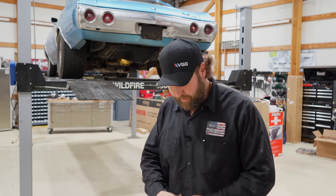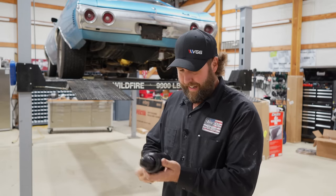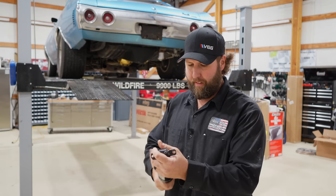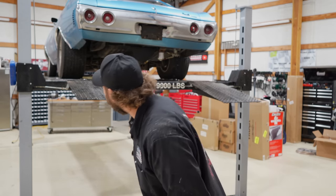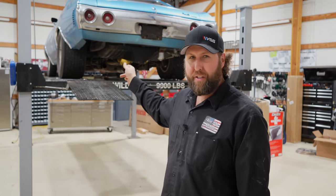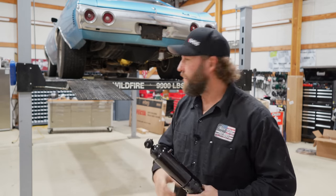Nope, I literally searched eBay and sorted by cheapest first, and it came up with this thing. I think it's a Monroe or something like that, but it looks similar to what came out of there, ish. So we're gonna pop this thing in. Should do the job. We only need maybe 2 inches of lift, ish, because we're gonna be swapping the tires on this anyway before we get it on the dyno. I just don't trust these. We're gonna put the old slicks off of the independent Chevelle on it, which is a much smaller diameter, so we're gonna gain a bunch of clearance there. Anyways, let's get these in.